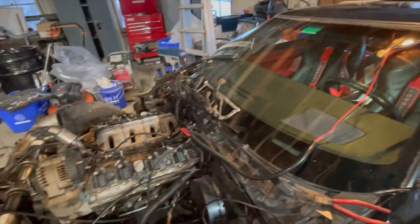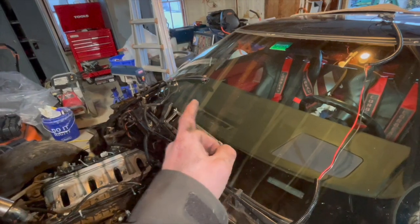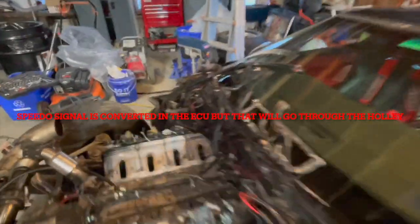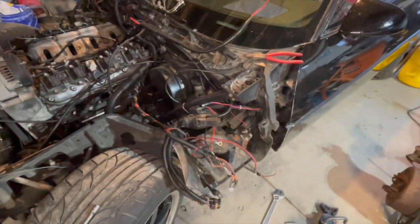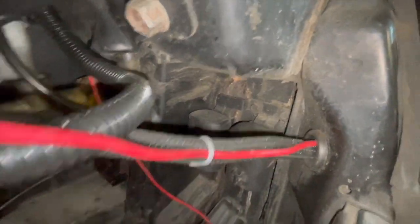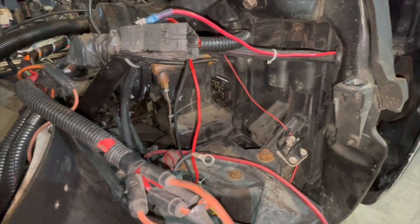My plan is to get rid of the ECU and its wiring. The blower motor and HVAC stuff is separate, other than the AC, which I think is switched on from the ECU — but I don't have AC anyway, I welded up a little box to replace that. I'm going to rewire with a couple of bus bars up here where these relays are mounted. I'll unscrew those eight-millimeter bolts, take this off, and probably mount two buses there and maybe two buses here.